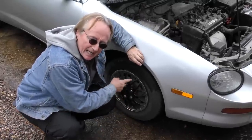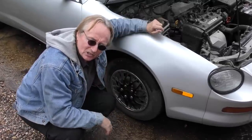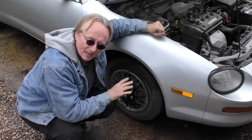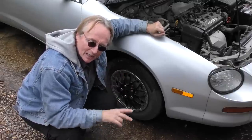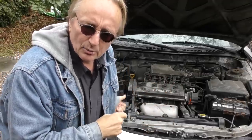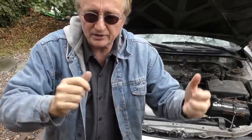Now let's say you have a bad brake caliper — the assembly that squeezes your brakes in. This can be a slightly different story. Over the years a lot of places say you've got to replace them in pairs, spending a lot more money because calipers are much more expensive than brake pads. But realize that they won't naturally wear exactly the same. For instance, your right front tire might hit more potholes than the left because you're sitting closer to the left wheel — you see a pothole and miss it, but if it's on the right you might not see it. So you can damage the right front caliper a lot faster. If you jack it up and see the right front caliper is leaking but the left one is perfectly clean, there's nothing wrong with just changing the right front caliper.